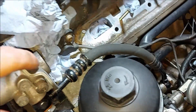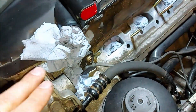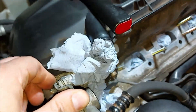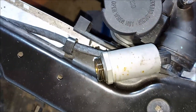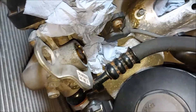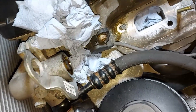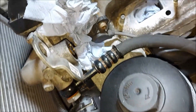So there we are - that's where it goes. It's a little T30 screw that holds it in. I'm going to give it a little bit of a cleanup, then lubricate it and chuck it in, then move on to the inlet cam sensor. Don't forget to fish the O-ring seal out - if yours is like mine it stayed in the hole, so you have to grab it with a little screwdriver. So now for the intake cam sensor - I've just removed the sensor that's up here by the VANOS. That's a 32mm spanner to get that off.